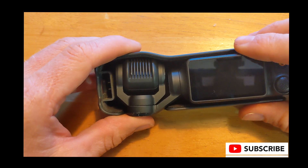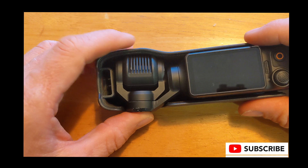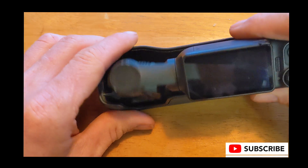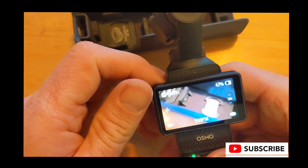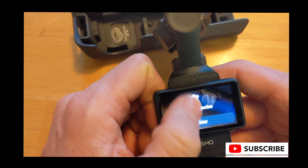What we're going to do to fix this is take off the back part of the gimbal motor, which is just a little sticker cover, and then loosen the screws that hold the gimbal motor to the gimbal mount. That will create less friction, which will reduce the frequency of this problem.